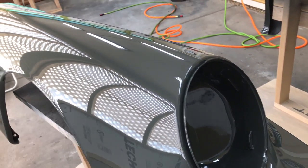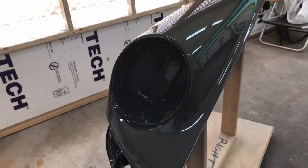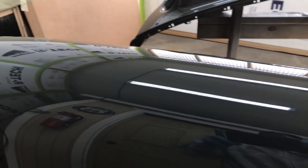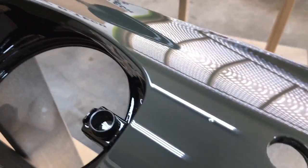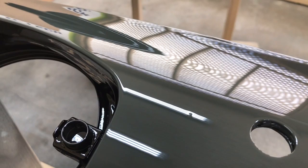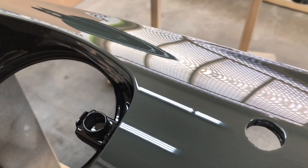I got through our third coat of clear. Everything seems to be drying up okay. The only thing I encountered was just a couple pieces of dust, and it looks like I might have had on one fender one piece of pollen. The problem with something like pollen as opposed to just lint-type dust — here's an example right here. See that little piece sitting right there? That's a piece of lint. See how it's sticking up? If it's sticking up and you have this, no need to panic. That will polish out and block out no problem if it's a piece of lint dust.